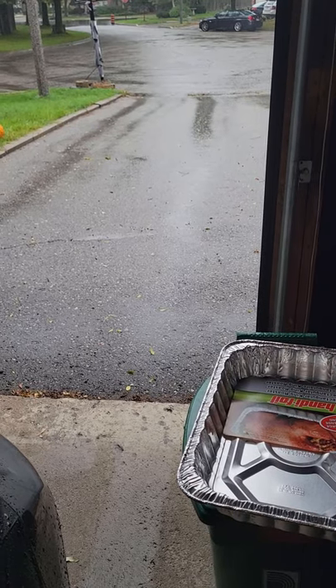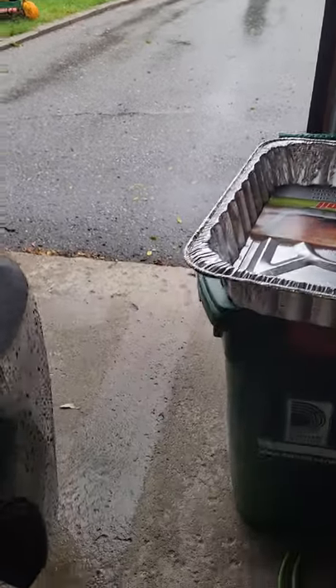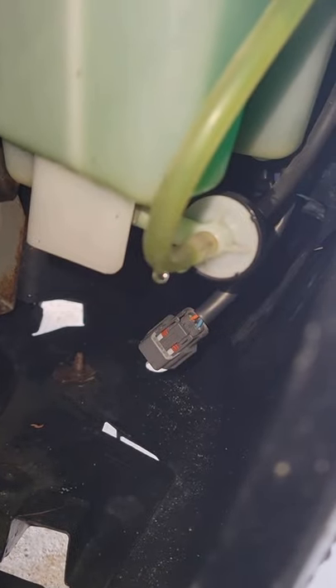It's raining outside, so I have to do this repair inside in the garage. Here, in the passenger side wheel well, there are two little clips — one there and one there. Take this tool and undo the clips. The next step is to pull this piece out of the way so that you can see the washer pump right there.